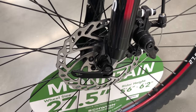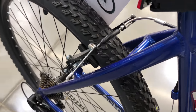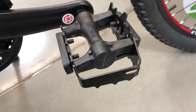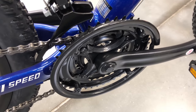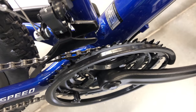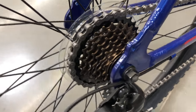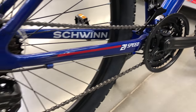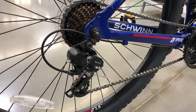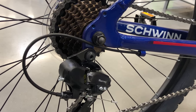Leaving the mismatched brake setup as the core difference — until I took this new stock blue model off the rack and gave it a closer look, specifically at the drivetrain. Up front it doesn't look too different, with the triple chainring and generic front derailleur. And even at the rear, it's a Shimano Tourney, just like my silver comp, in a 14-28 tooth 7-speed freewheel. But look back over that drivetrain, because I didn't see this until I'd taken the bike off the rack and looked at it a few times. Look closer at that rear derailleur, at the derailleur hanger.